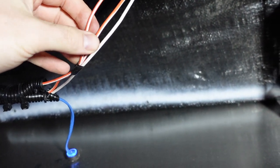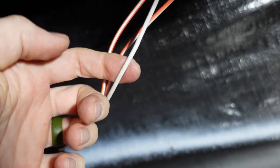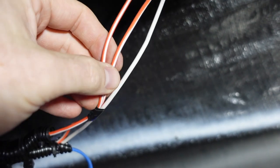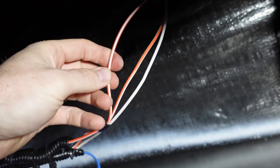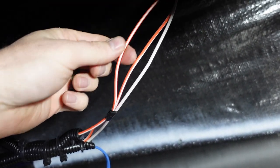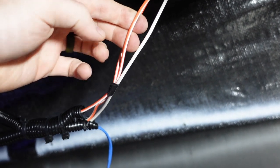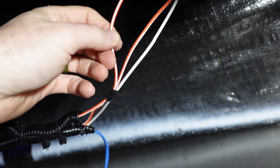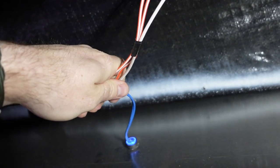You've got two wires that are orange with a white stripe, both the same, and a plain white wire. Typically plain white wires are your negative or ground — 12 volts, positive and negative. One of the orange-stripe wires is the 12-volt positive coming from the BM Pro node; when you switch the node on and off, it sends 12-volt power through that wire. The other orange-stripe wire runs to awning number one. Originally there was just a butt splice here — they did not use the WAGO connectors used elsewhere, because water can get up in here from the road.